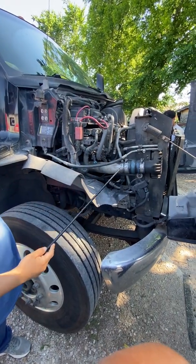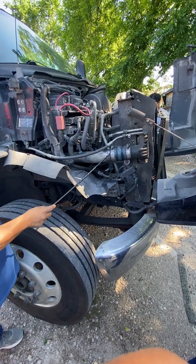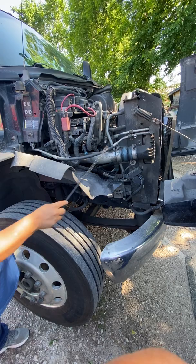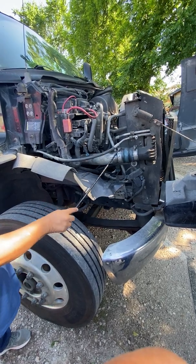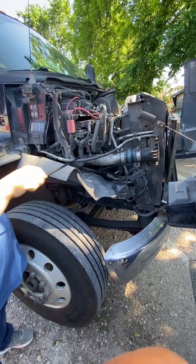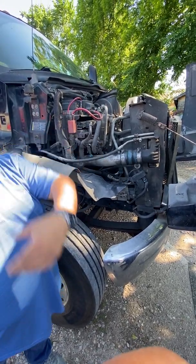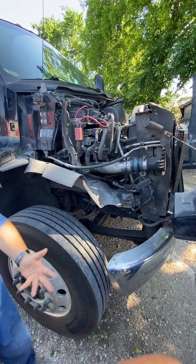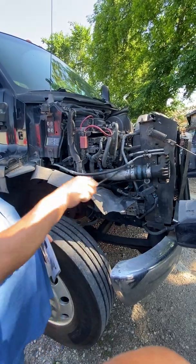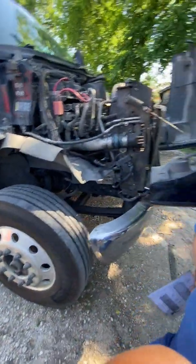because I don't want any hoses to be loose or falling off, and I don't want any leaks where the hoses are connected to anything. Once I'm done checking that all the clamps are secured and I don't have leaks at the connections, I also have to inspect the hoses themselves, looking for abrasions, bulges, cuts, anything that's going to cause them to leak the air or the fluid that's inside of them. Nothing has to be a specific name, just hoses. Cover them all, and now I have to go do the same thing on the other side of the truck.